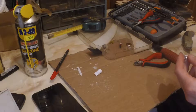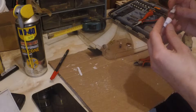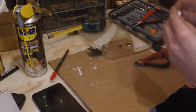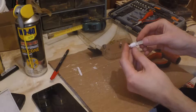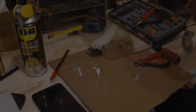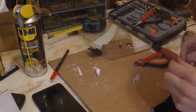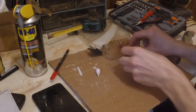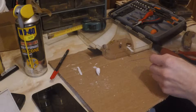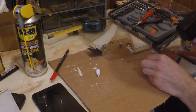When you're done soldering, you test out if everything will fit in place. You have wires long enough to poke out on the T10 casing and at the end you will add a resistor. If everything fits, looks like you've done a good job till now. Here I used a 1 kilo ohm resistor, but the recommended one was a 330 ohm resistor. I didn't have 330 ohm ones, so I used the 1 kilo ohm resistor. The LEDs are in series with a 1 kilo ohm resistor at one of the ends.